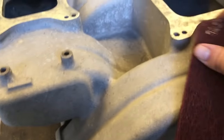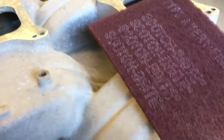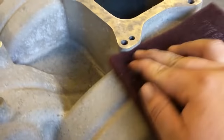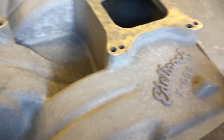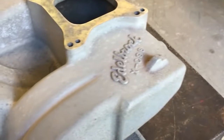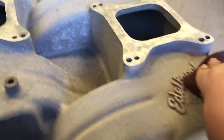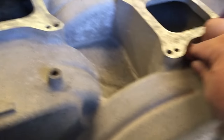If you don't know about Scotch-Brite pads, learn about them because they're awesome. Use brown pads — you can get them at most any paint supply store or auto parts. Essentially what you're going to do is scrub this entire intake. Once you start hitting it, you'll see that oxidation — see it just flying off? Almost like smoke coming off of there. What you're doing is getting all that oxidation off, plus roughing up that surface just a tiny bit, so it's cleaning it and preparing it.